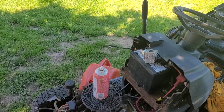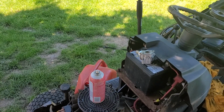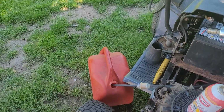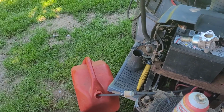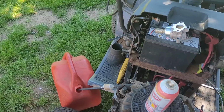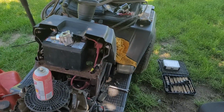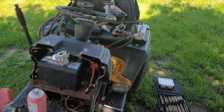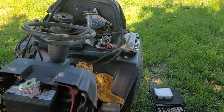I'm going to be running the new fuel line straight through where the old ones were, and hopefully everything will work out. I have drained the tank. I wasn't going to, but I did decide to do that. Next is to either reuse that filter there, which is actually a new filter, or use the one in the kit, get the fuel pump installed, and we'll try this out. Like I said, for the wiring, I'm just going to temporarily hook it to the battery, and we'll see if this machine will run in the next video.